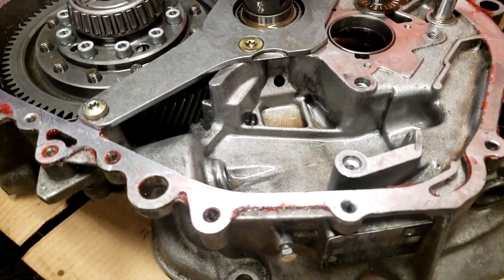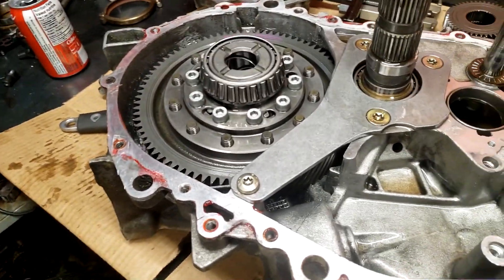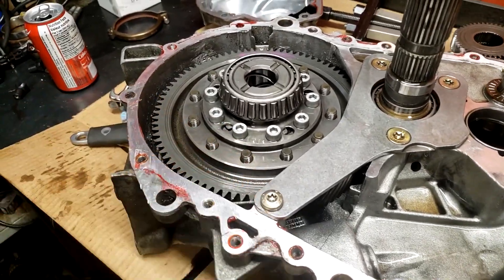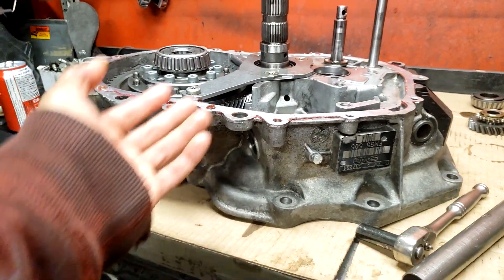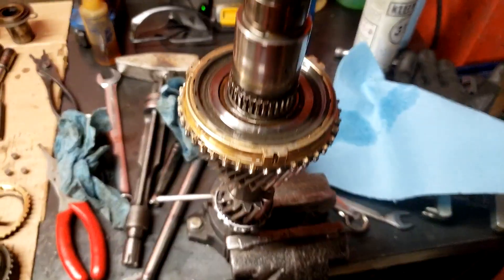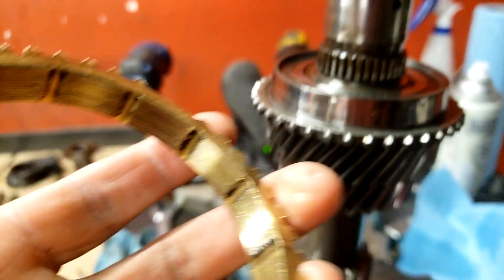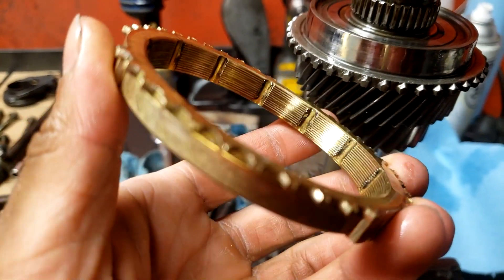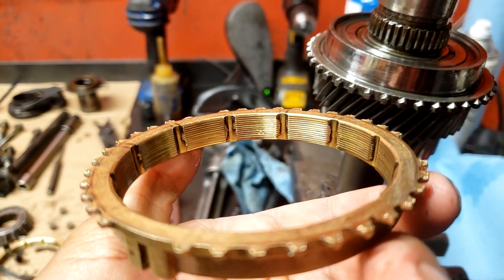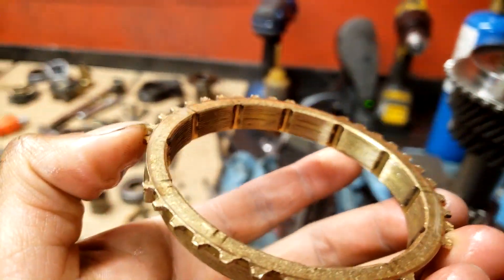I'm not expecting to see any more damage. This case is already brutalized - the ring gear basically exploded in here, teeth got shredded right off, and there are welds on it. This whole transmission has been terrorized. Input shaft taken apart - you can see how low this synchro sits on third gear and how flattened these grooves are. It's hard to see on camera, but there are always going to be grooves - they should just be a lot deeper. Anyway, that's the worn synchro.